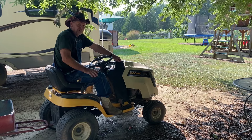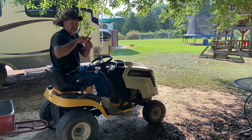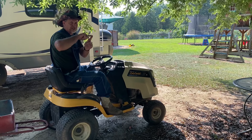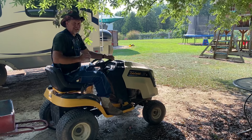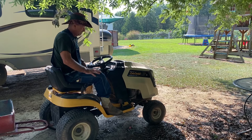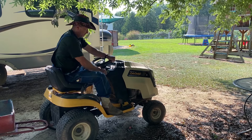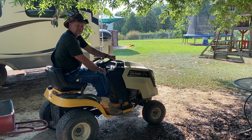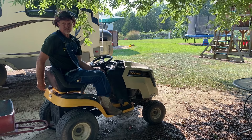I'll go on and tell you, some of them you can just unplug, but some of them you've gotta unplug and take a piece of wire and make a jumper wire to fool it into thinking somebody's sitting on the seat. But anyway guys, I hope that helps some of you out there. If your lawn mower is clicking when you want to crank it and won't do nothing but make that clicking noise — you can hear it back here clicking on the solenoid.